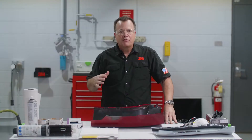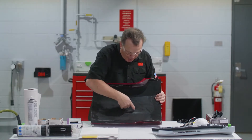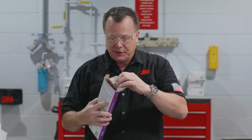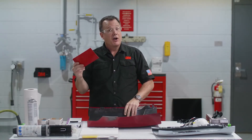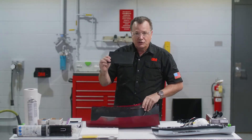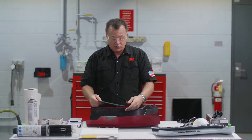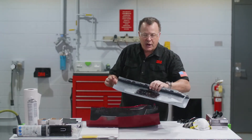For this repair, what I'm going to do is apply a patch to the backside. This is the 5888 Flexible Bumper Patch. The nice thing about this patch is you don't have to wait for adhesive to cure. It's real easy to use, and it sticks very, very well - it's not going to come off, I guarantee that. So what I'm going to do is cut this to size and apply this. I'm going to use an adhesion promoter as well.